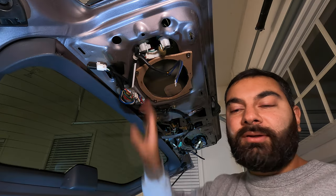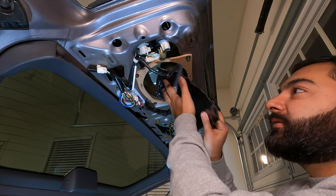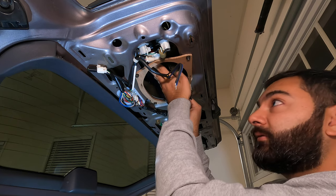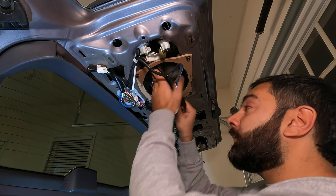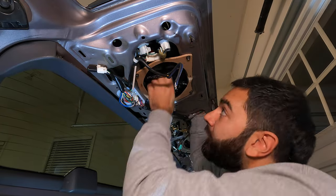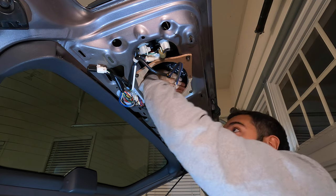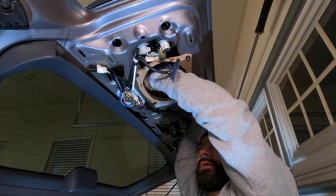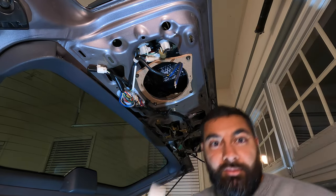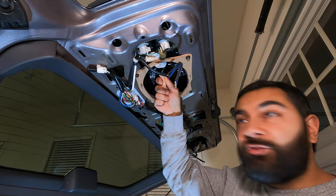But before we go ahead and mount the speaker, I'm gonna put in some sound deadening just to absorb some of those vibrations. I don't wanna make it stick anywhere just yet because once it touches something, it grabs hold real tight. So. In a good spot now. So I'm just gonna push it down by hand first just to get that contour sticking well. And then I'm gonna use a little roller just to smooth it out and make sure there's really good adhesion to the surface.